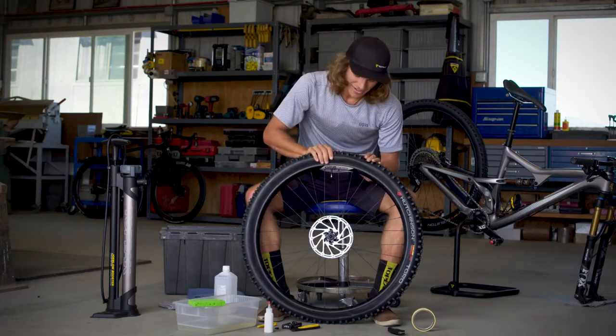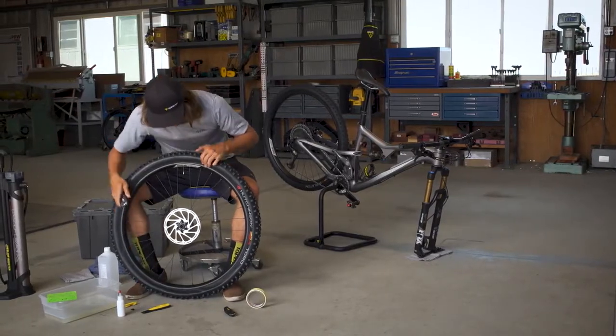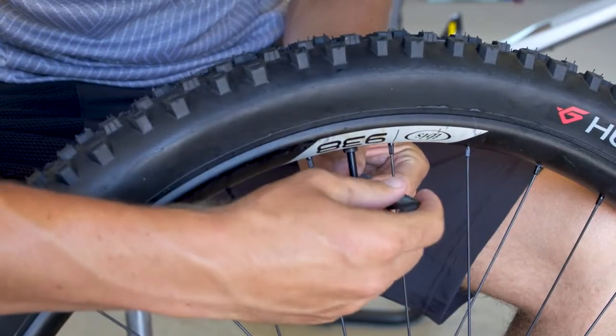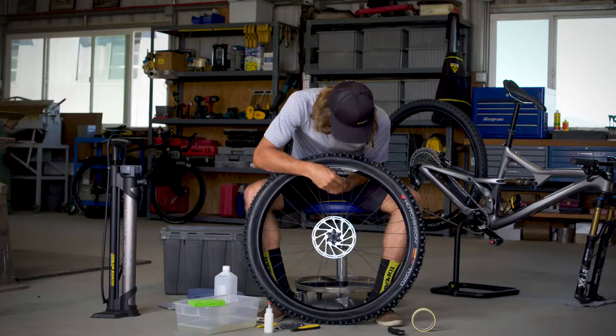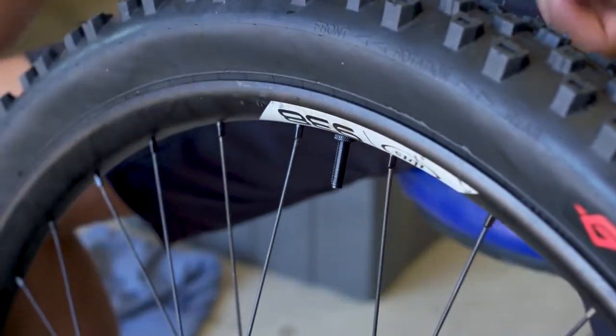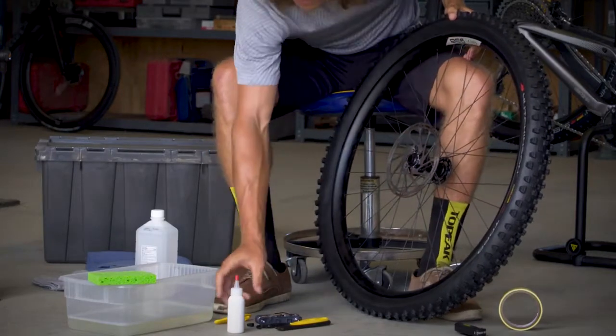So now that all the air from our dry run is let out of the tire, we're going to need to remove the valve core from our stem. You'll need a valve core removal key. So we're going to do some gentle rotations on the valve core, careful not to strip it, and take out our valve core. Keep the tire so the valve stem is up.